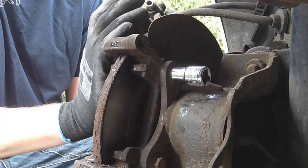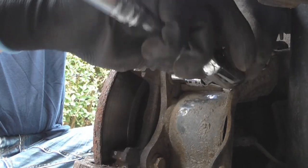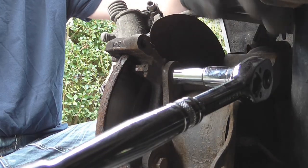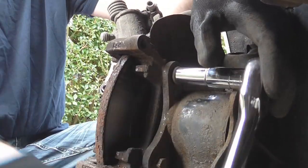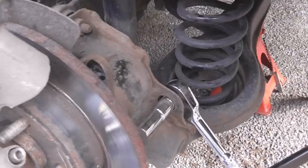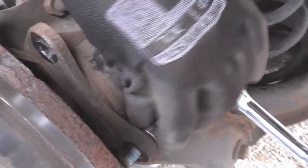You can tie-wrap the caliper out of the way if your pipe's long enough, but there's nothing to tie-wrap this one to in this car, so I've just got it sat on the front of the hub. There are two 13mm bolts that are a struggle to get into, so I've got a long 13mm socket which just clears for the ratchet so I can undo them. Ford have kindly put a hole right in line with where the bottom carrier bolt is, which means you can get your ratchet in.